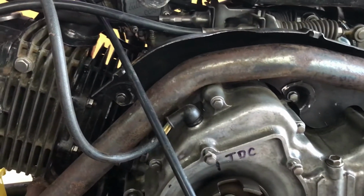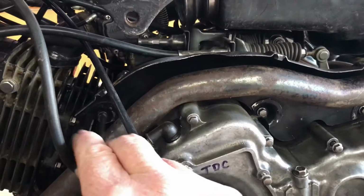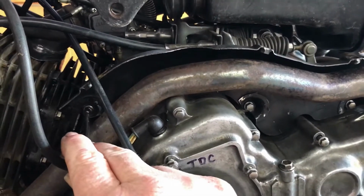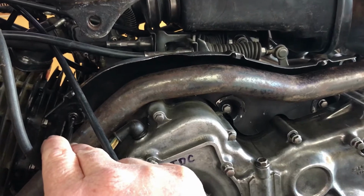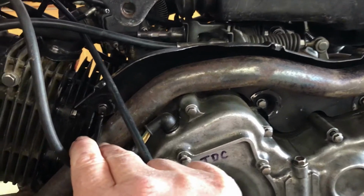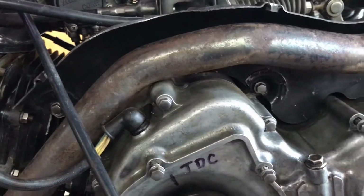And I could have just decided, oh, well, it doesn't really matter, it's a screw that can get in the bloody way when you're taking the bike apart in future. And I've seen people do videos to say you just leave that one out because it's in behind the pipe. But I decided, no, I'll center punch the center of the boss that was on the cylinder wall there and drilled it in location. I drilled it out 5mm drill and then tapped it M6 so that I could put that screw there in place. So the three screws in this shield are now in the correct locations.